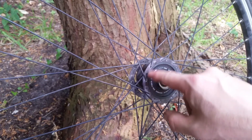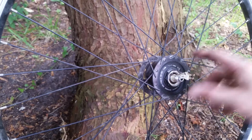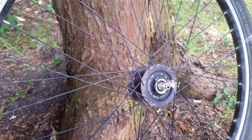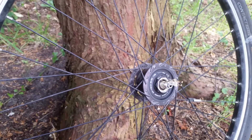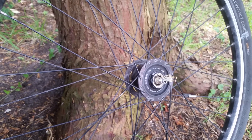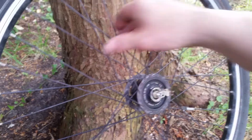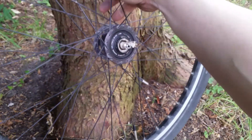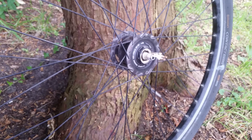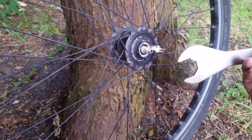You need a special tool, and that's of course a bad point for doing repairs on the roads on long tours. That's an issue with recommending Shimano dynamos in general — you can't do repairs on the roads on the bearings if needed. That's impossible with the SP hubs, and with the Schmidt hubs it's also not really possible. Here with the NX70 it's also not really possible anymore.